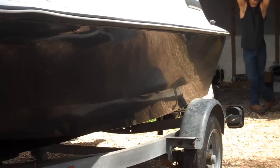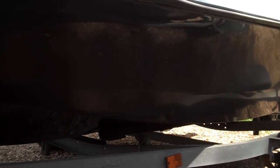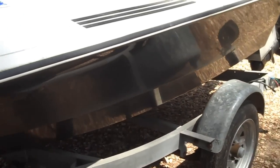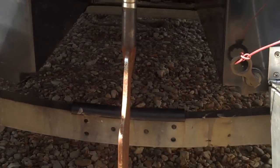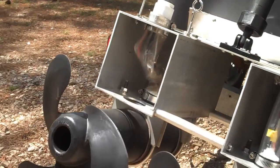You can see the hull's perfect on it. That's about it — that's as far as we've progressed. We took her out, and with all the weight in the back end she still ran good, but she didn't steer well. The rudder's got to be changed — the rudder in the back end is too small. It needs to be about twice the size as it is, and probably lowered down about 2 to 3 inches. Everything else operated perfectly.